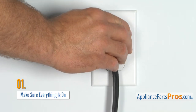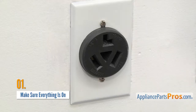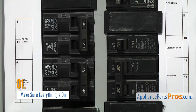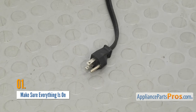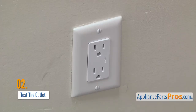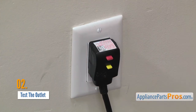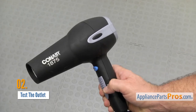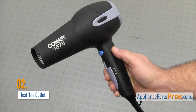Start with the basics. First, make sure your appliance is plugged in and the water or gas is on. Check the outlets themselves for signs of damage as well as the circuit breakers. If you've recently had appliance or maintenance work done, it could be a matter of someone accidentally forgetting to plug something back in or turn something back on. You can test your outlet by simply plugging something into it that you know works. Something small that can be operated handheld is easiest, something like a hair dryer. If you plug it in, turn it on, and it works, that's great. If it doesn't, then you know something's wrong with the outlet itself. Unless you're an experienced electrician, you should have a professional look at any wiring issues.